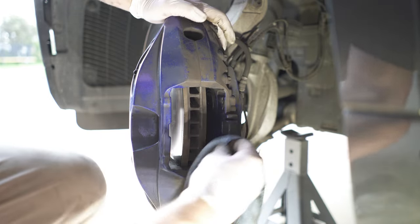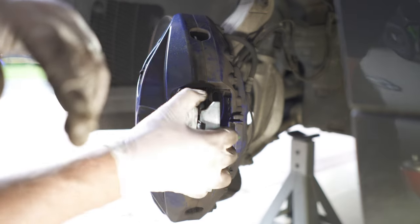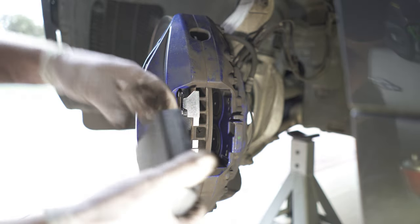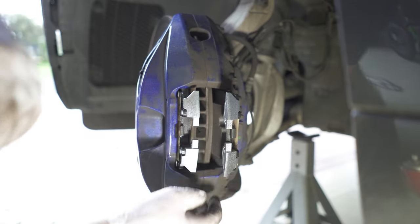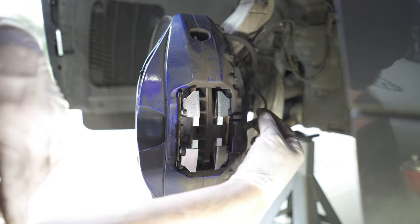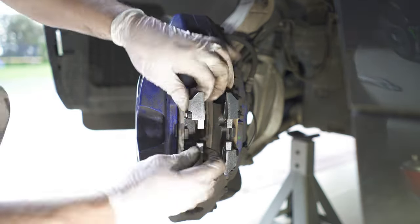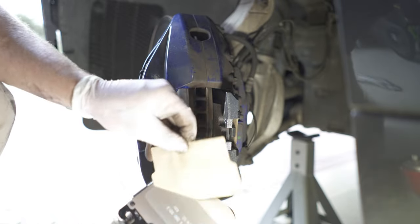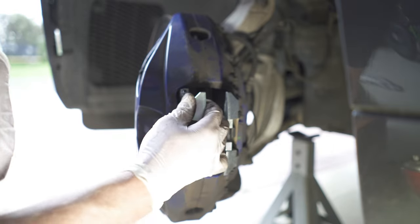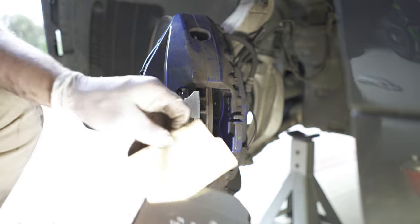This is the final clean — all the adhesive is gone. Now I'm going to use the new pads, push them in, and remove the film of the adhesive. Because this is just a trial run, making sure I've got enough room and that everything fits the way it should. Once everything is good, I'm going to remove that film. I don't want to stick it to the pistons yet, so I'm trying to keep it towards the disc — the rotor — at this point.